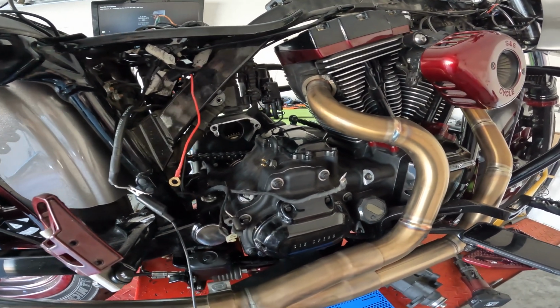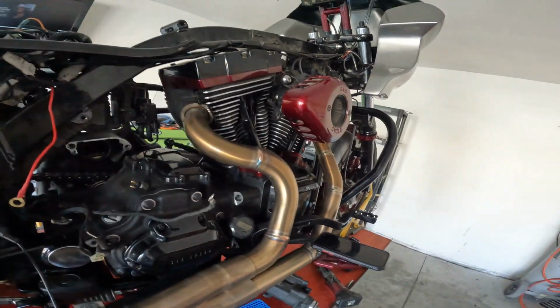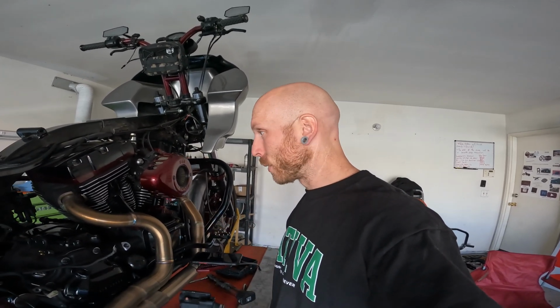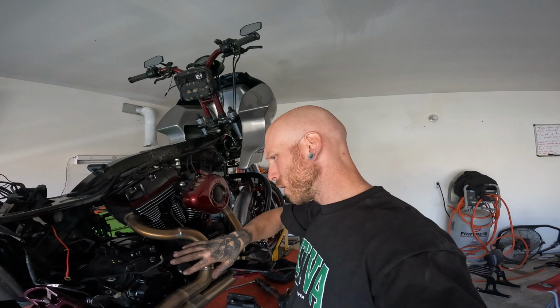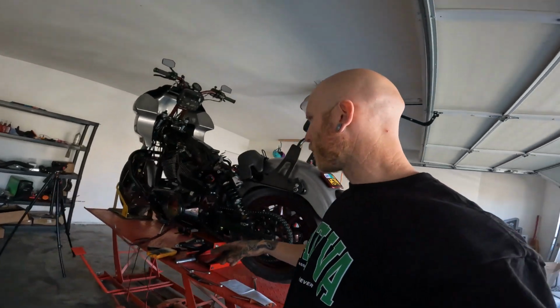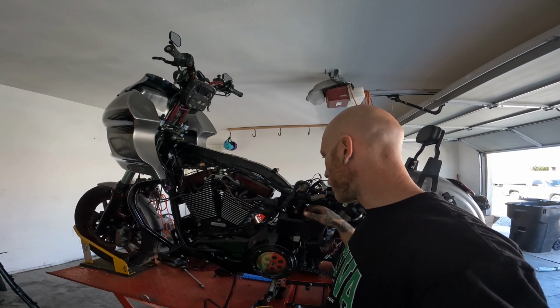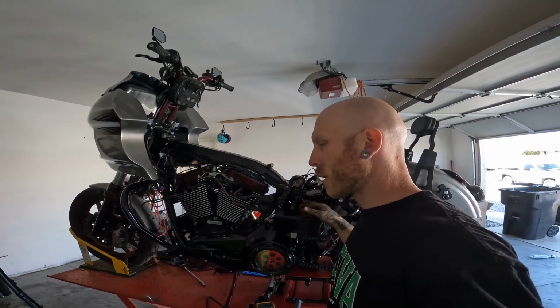I don't know, guys. Electrical is just one of them things. It's either done quick and easy or it's not. There's no telling what we're gonna find on this thing, because honestly, I am about clueless right now. So I cleaned up that sensor. It's not making the noise it was anymore. Checking all the connections. I don't understand. I need to verify why, when there's no fuse in here and the power's all hooked up, one of them is showing as ground until you put power to it, but it's not shorting because the fuse is staying good.